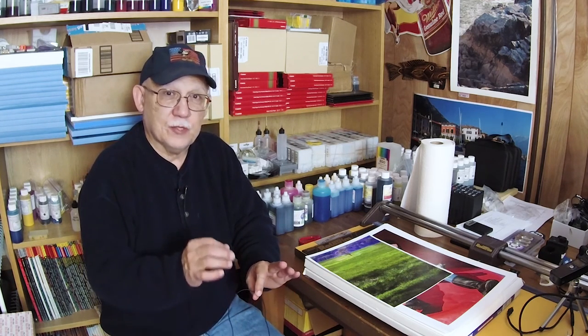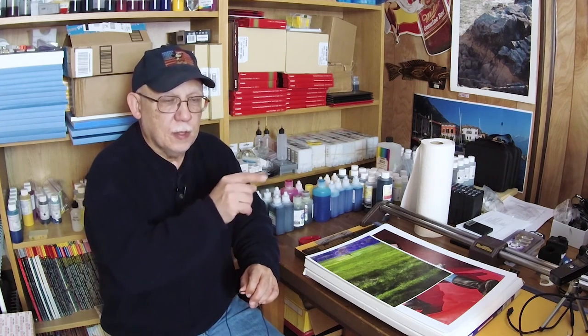So the other day I was printing something to the printer and I didn't realize that the driver had switched itself back to photo glossy paper. So of course it triggered a black ink change. And long story short, I cannot get my matte black to print anymore. So I think the valve itself is shot. So I am looking for a replacement ink delivery system for it.